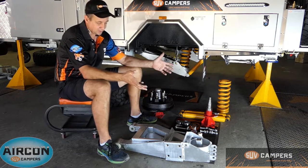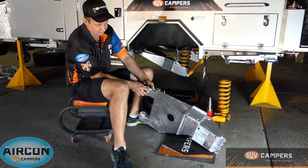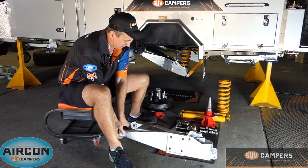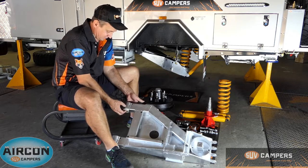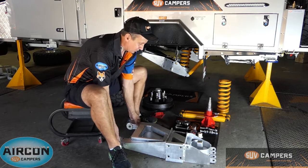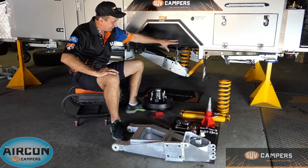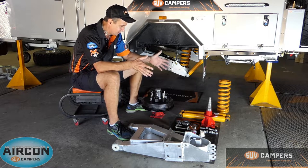With the new Series 4 suspension arms — we've also got Series 3, Series 2, and the original suspension arms out there, all going gangbusters — this one in particular is a Series 4. You can see it's all been reinforced along the sides of the suspension arm box section; these are 6mm wall thickness. You've got 16mm wall thickness steel collar tube on the end, and then your nylon bushes go in — all six bushes go inside with a crush tube. Once that suspension arm is fitted into your camper trailer with the coil and shocks, all bolts and nuts are locked and tied — we don't leave anything to chance.